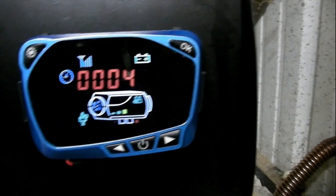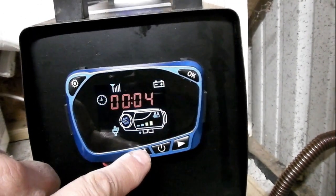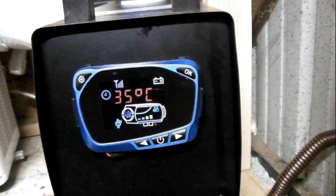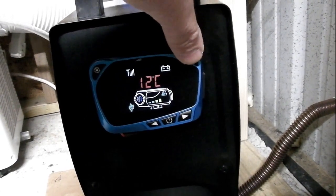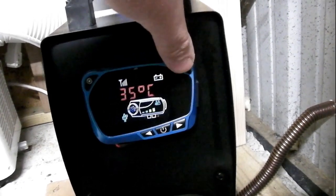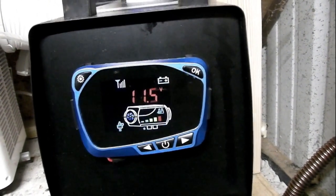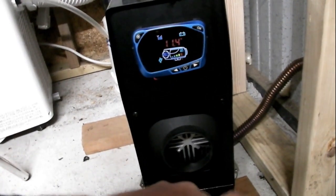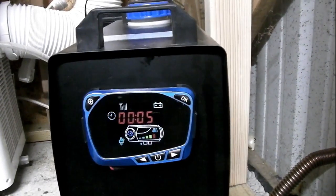Okay, it turned the glow plug off — you can see there's no symbol anymore. It's starting to fire up fast now. Another thing I did was set the heater for 35 degrees centigrade, which is the maximum temperature — that's like 90 to 95 degrees Fahrenheit. Since the glow plug turned off, the voltage has recovered to about 11.5 volts. It's running and humming pretty good now. We're at five minutes so far — we'll check back and see how long it runs.